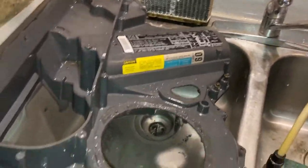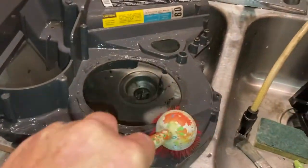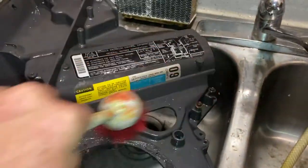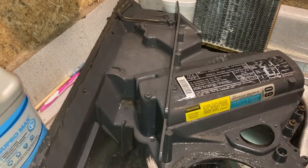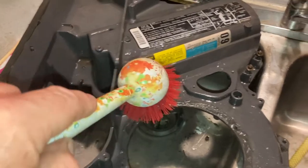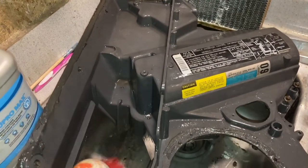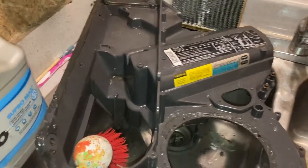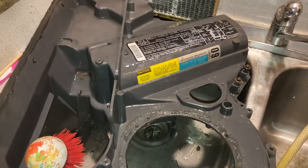And I think this was C60 AC. Just the manual, you know, rotary selector valve, servos driven by vacuum. And then C65 was the automatic air. I got that in an A-body, a 1980 A-body. And then, if I'm not mistaken, C68 was the electronic touch control. Oh, my God, were we plagued with problems in those things. Those panels would fail all the time. They weren't the best mousetrap.